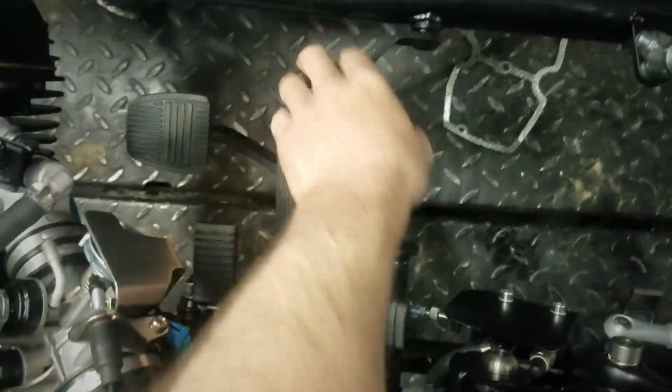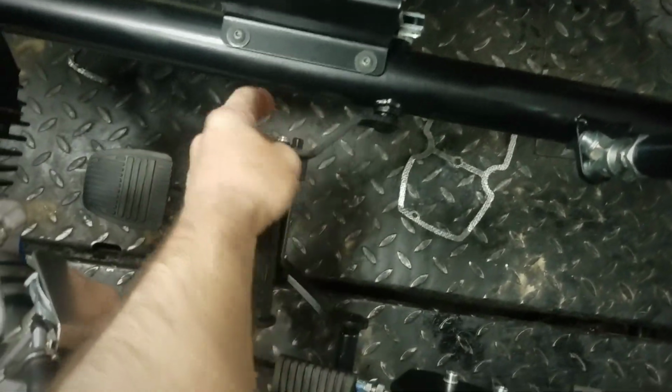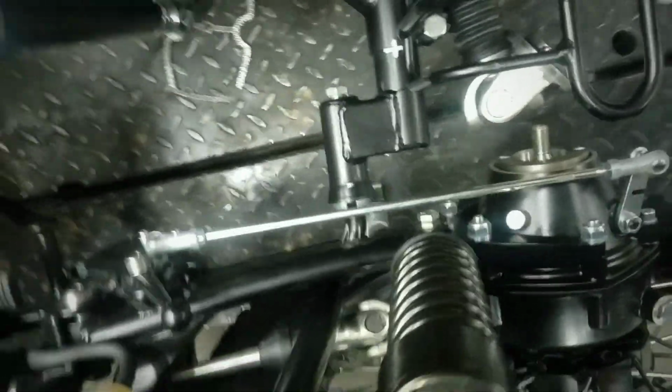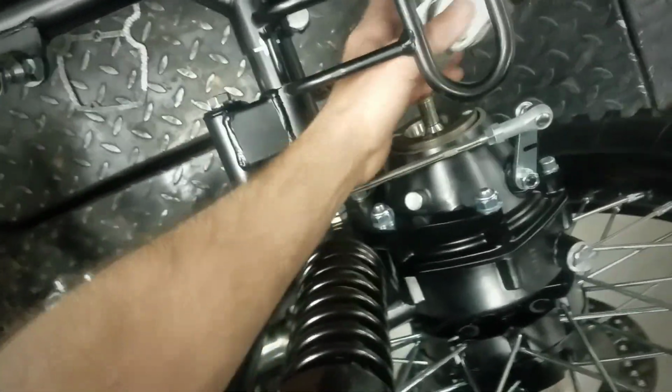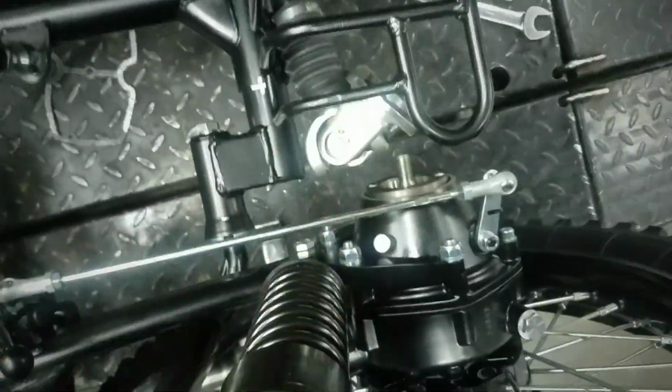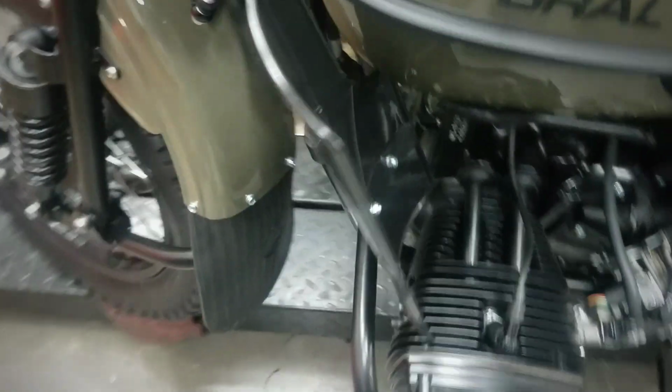You see there is enough flex there. We're putting upward pressure there on that brake link, so you may have to take this loose if you needed to bend over some more. But what I've done is I've twisted that over a little bit because that pipe has to come up through that hole. In order to get the pipe up through the hole, I wanted more clearance. So we went ahead and we've got our drive shaft loose. You see here, just took the two bolts out of there. Be careful you don't lose your top hat spacer that's in there. Piece of cake. So we'll go ahead and get that pipe slipped up in there, get her put on, show you how it comes out.